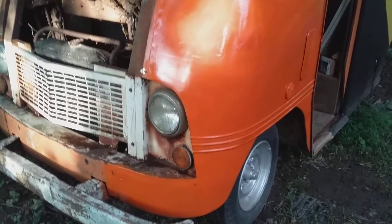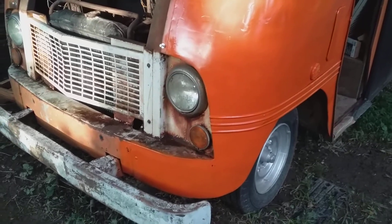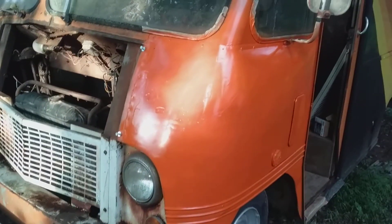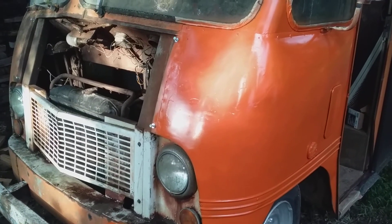I don't know if you can see it move, but that's not bad. The pedal works, it's all bled. The pedal goes down about a quarter and locks up because the slave cylinder is locked up. I actually got one, but I'll be taking that apart next time. So, the master cylinder for the clutch.